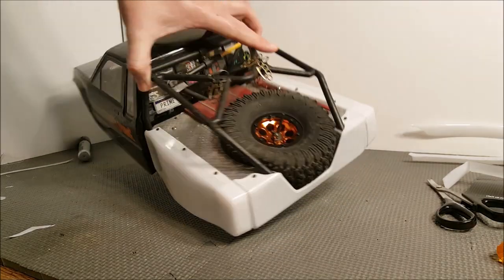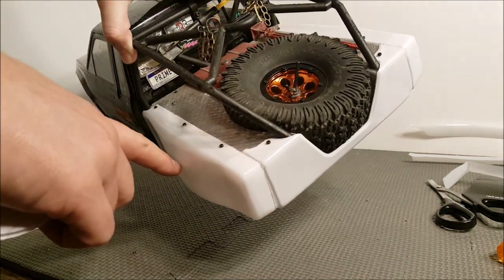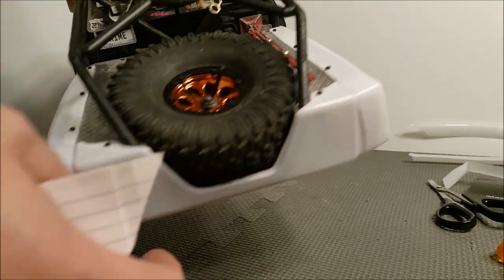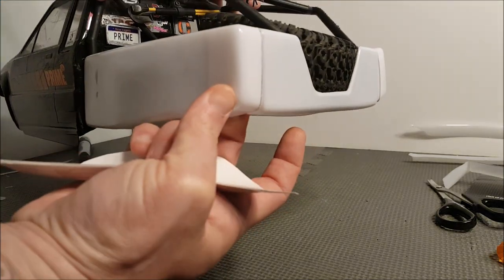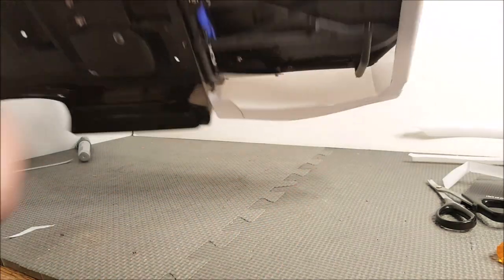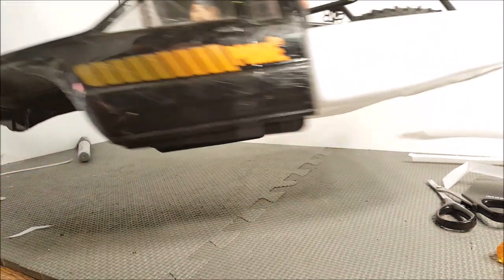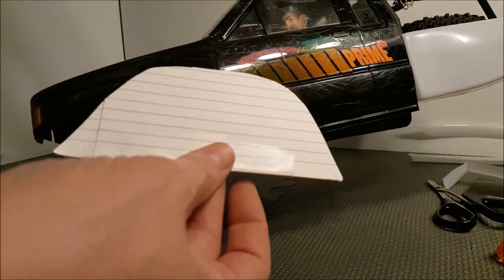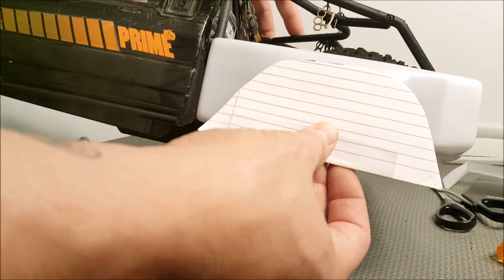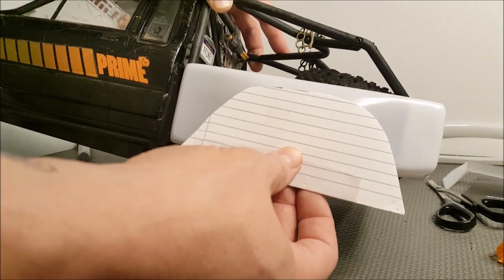I have the bedsides mounted up. A little warning here — they do have dimples for the screw holes, but put the bedsides on to make sure they line up where they're supposed to be, because on one side they did not. Make sure before you drill. I'm going to drill a hole in the corners and put a bolt there to hold it together. For the wheel wells, I took the front wheel wells and traced them out on an index card — a couple taped together — and I'm going to use that as a rough template. I'll draw it on and see how I like it and adjust as needed.